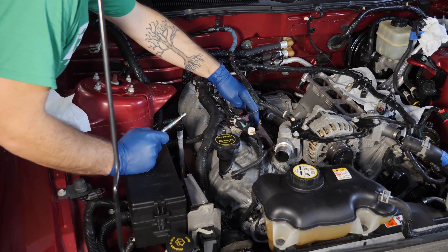There's a coolant connection on the back — once you flip the bracket up, just push the white tabs and pull the connection off. I set some rags down underneath to catch inevitable antifreeze leakage. I might as well go ahead and take off the alternator since we're right here. There's just a 10 millimeter bolt holding on the positive lead, and then a regular connector you push down and pull out. Loosen that connector, pop off the lead, and the alternator is disconnected. Take your 13 millimeter nuts off and it will lift right away.